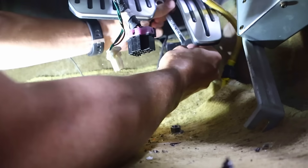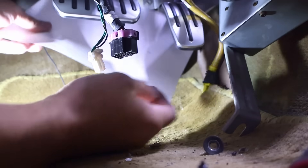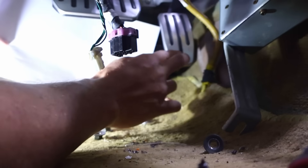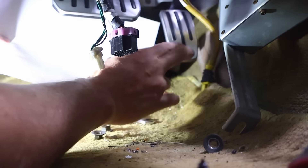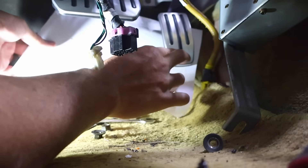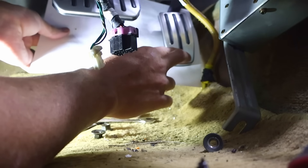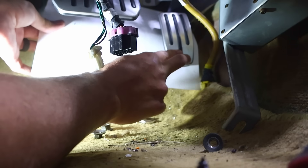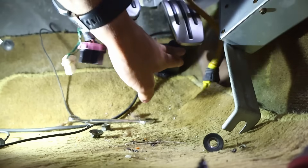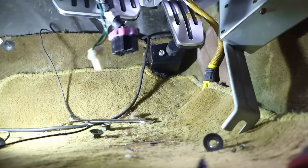Here I'll demonstrate what we've got. With a sheet of paper behind the pedal and the rubber stop — you can hear it hit its stop. When it hits the stop, the paper can move freely. But if I keep pushing, the paper gets stuck. That's exactly where we want it — the rubber stop won't affect full travel, but if you keep pushing, the rubber stop will absorb the force.